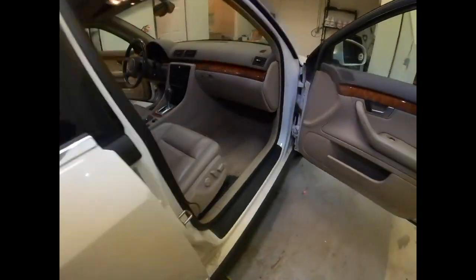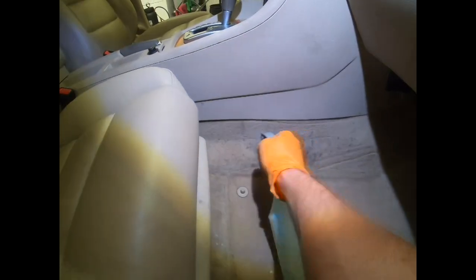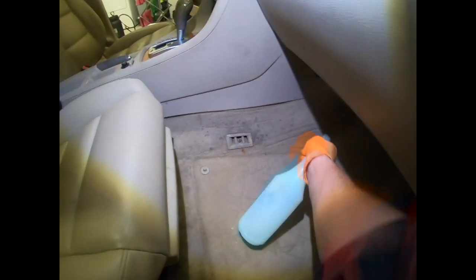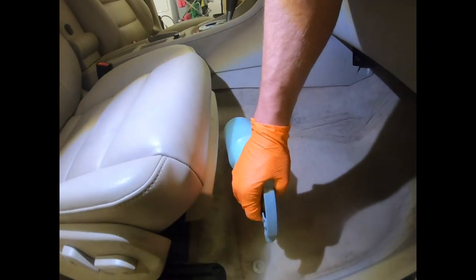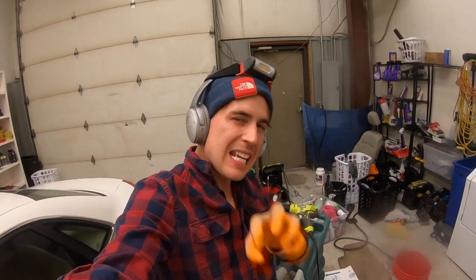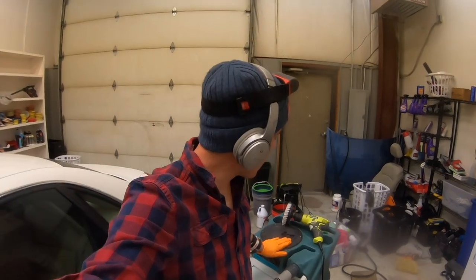Once you've extracted this out of the carpet — you spray it, give it some dwell time, then agitate it with just water. You want to get most of the crud out. That's when you can go about cleaning your carpet with a pre-spray and a neutralizing rinse. This is a little redundant, a little crazy, but I'm just aware this is an older vehicle and I'm trying to take back years of possible neglect. I used a drill brush to get some of that urine neutralizer into the carpet, really working it to neutralize the salt.